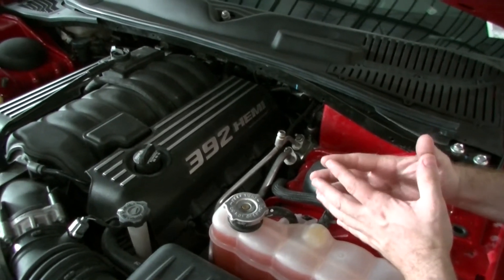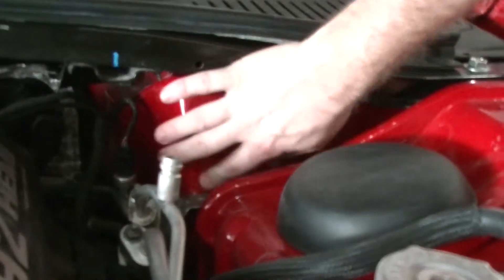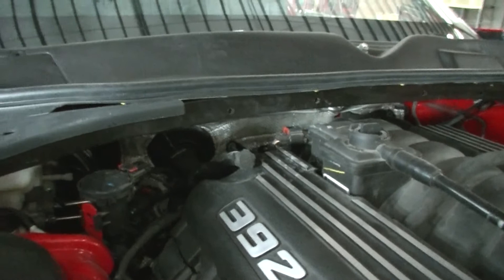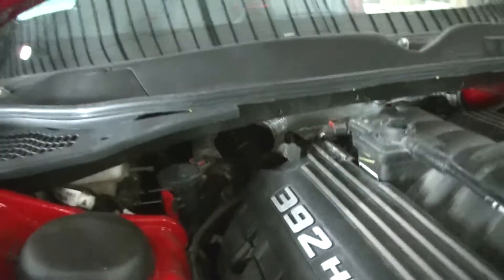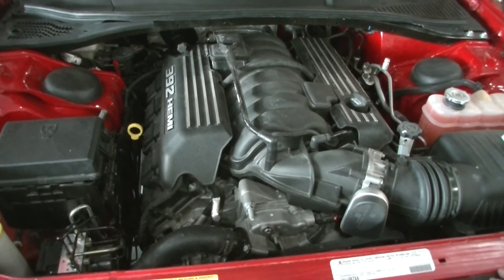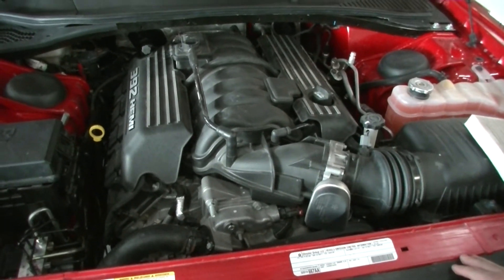We're using a 300C Chrysler rack for the steering. Under the bonnet we've also created a wall in here for the fresh air intake — the original used to have one on the other side and we've recreated this one here. At the back you can see a heat-proof shielding that we've made — it's a heat-proof fabric that we've attached to the firewall just to provide some more insulation, replacing the original manufacturer's one with a new sewn one with all sewn edges, all heat-proof. The motor was removed out of the vehicle because we had to do a modification on the bell housing to put the starter motor on the opposite side of the vehicle to allow for the steering intermediate shaft to come through. While the motor was out, we re-sprayed all under the bonnet, so it's nicely finished under there.